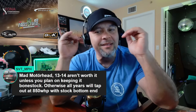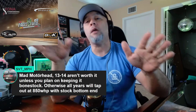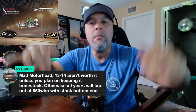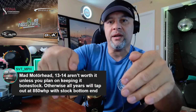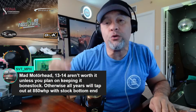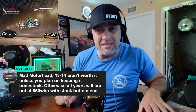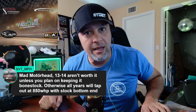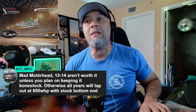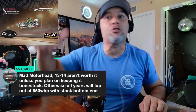I agree. Remember when I said that the 11 to 12 GT500s were the better buy and people thought it was nuts because they make 662, 13 and 4? It doesn't matter the moment you start modifying it. You can get an 11 to 12 with 373s from the factory. You have 331s in the 13 to 14s with a 2.66 first gear. You need a 373 with a 2.66 first to get out. But no, Ford wanted to go 0 to 60 in first gear, so they made first gear so long, with 331s and a 2.66 first, and then the 200 mile an hour top speed.